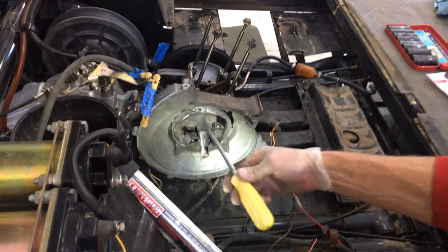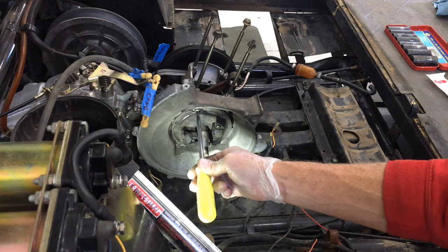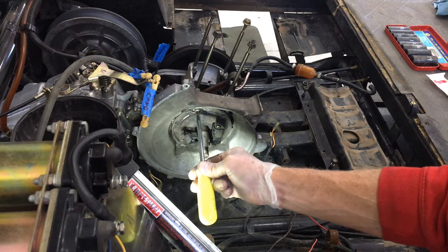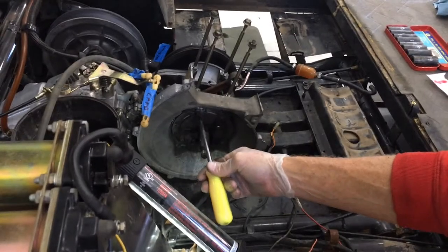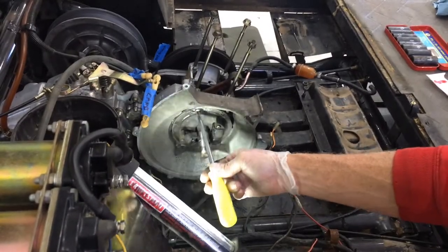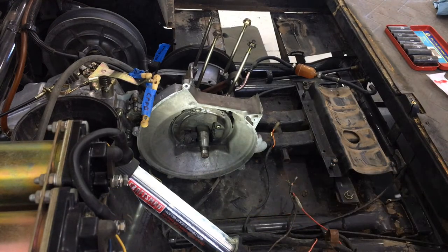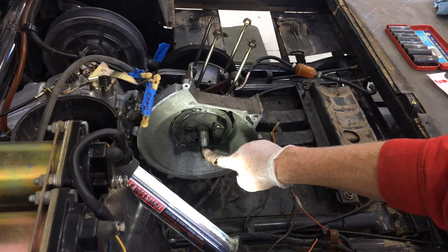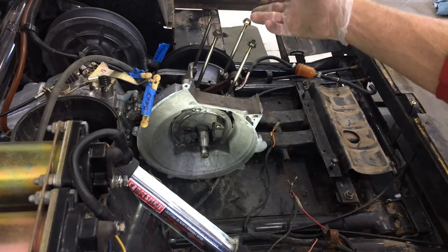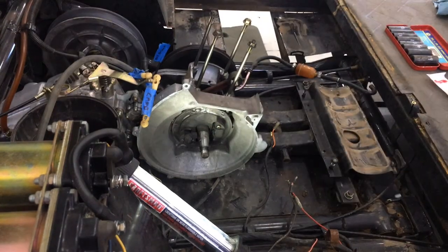Another tip somebody suggested: always use the biggest screwdriver bit or point so you have no slop in the screw head, and basically wrap a wrench on it a few times to kind of break the lock on it. I've also done that on the bottom screw. It's similar to what you do when putting pullers under tension when pulling off the flywheel or the clutch sheave - give it a wrap on the bolt and that just kind of breaks things loose.